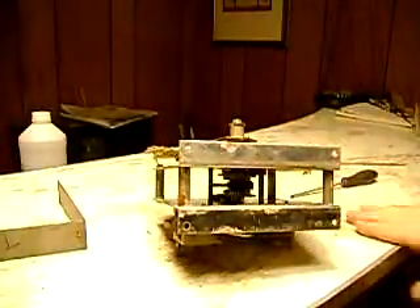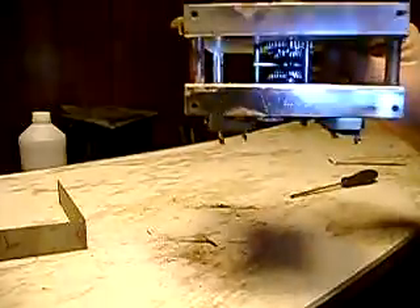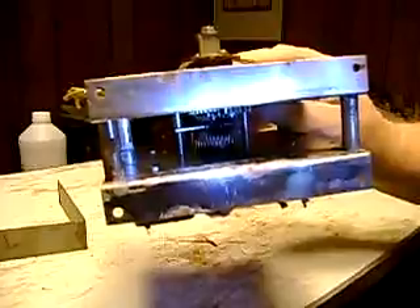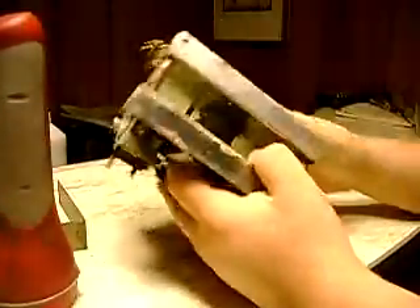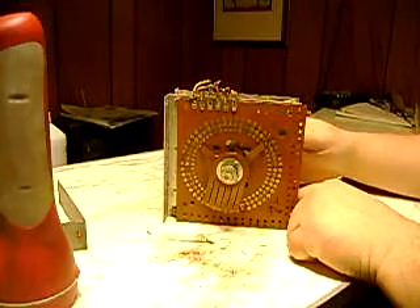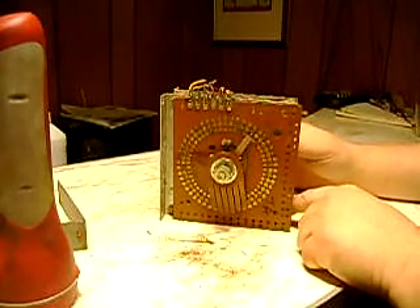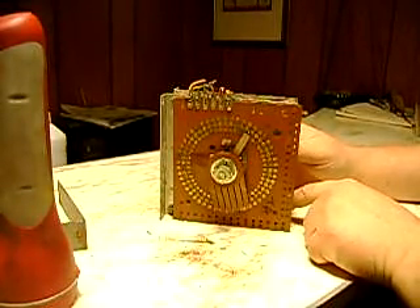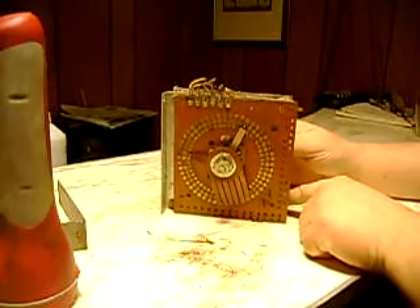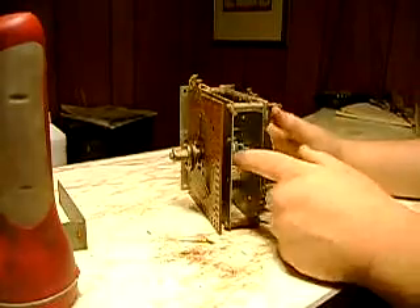There's my flashlight. Let's see if that's getting filmed. The problem is, if this pin is out and that can rotate around freely, this disc will end up in places where it ain't supposed to be — like if it comes up over here somewhere. That caused this game to have a peculiar short — it's shorting right through the reflex. Every time the number one mixer is in a certain spot, you blow your 50-volt fuse, and it's very hard to figure out. You had a game that was working for a long time, maybe you had a couple big wins, and next thing you know it's shorted out. It's probably because this has walked into somewhere strange where it shouldn't have. It's definitely worth checking those pins in there.